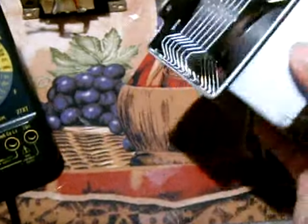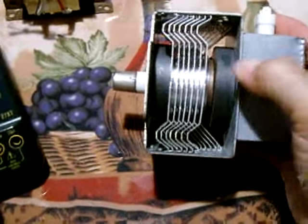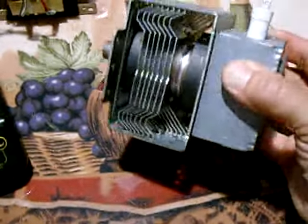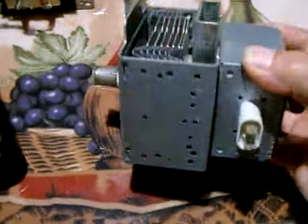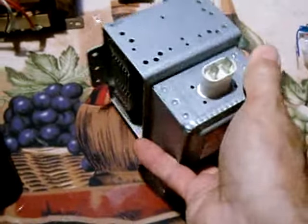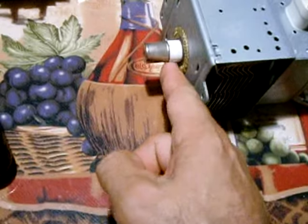Now to check the magnetron, take a look and make sure there are no cracks. Look at the magnets — there's one here and one in front — make sure they're not cracked. Look all the way around, then shake it and make sure there are no rattling noises. Also check the white part all the way around and make sure there are no cracks there.